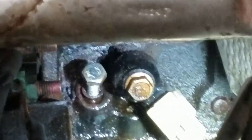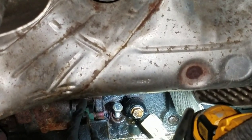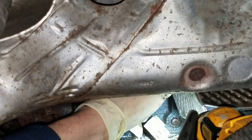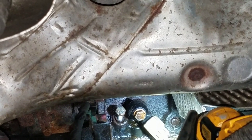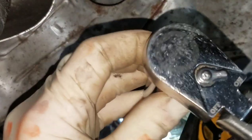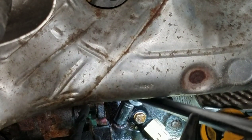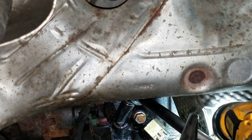You can see it's going to make it hard for it to come out, so this is why I had to put a socket and extension on this. I'm going to try and straighten it a little first, then I'm going to put a ratchet on it and try and get it spinning. Now I'm just going to put a ratchet on it and see if I can get this spinning. Alright, I actually got it spinning — if you can get it to that point you're doing pretty good.